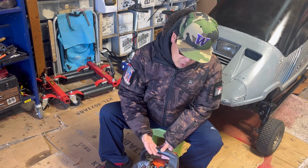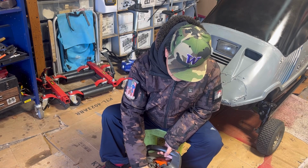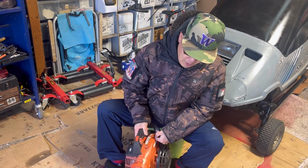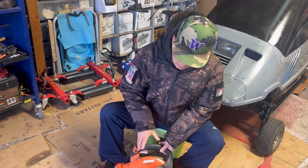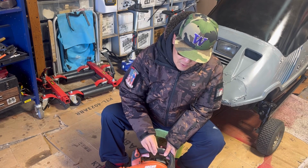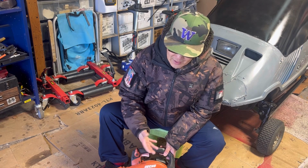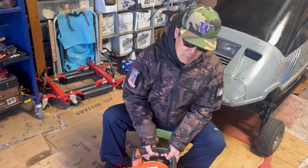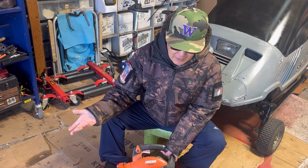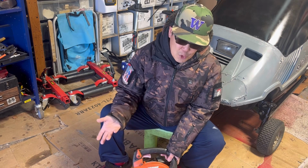But for you to even troubleshoot this to try to get it started, you have to be able to test it. And you can't test it with the engine locked up like this. So you could take the whole thing apart and try to move the flywheel, try to loosen it up. I suspect that the magneto is fused and rusted to the flywheel because somebody left this thing outside in the rain. Maybe this thing was inside somebody's swimming pool or thrown inside like a lake or something like that. It could be completely done, but you're not going to find that out unless you try, right?